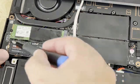We're first prompted to select the language — I'll pick English. Then we have the option to change the keyboard layout; I'll stick with the US keyboard. Next we have the option to enter a shell command or start Clonezilla — go ahead and pick Start Clonezilla. We're then prompted with a menu to decide how we'll use Clonezilla; the option we want is device-to-device, which is the second option in the menu.